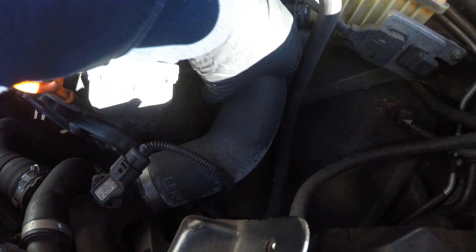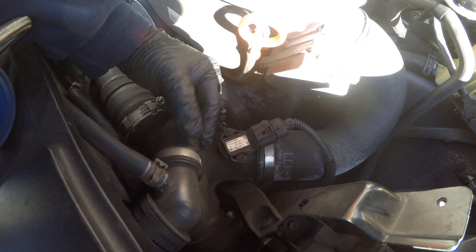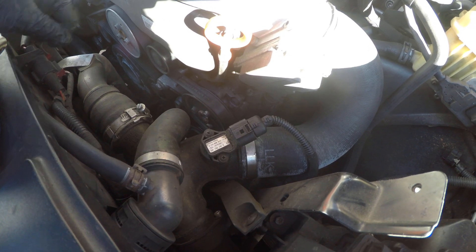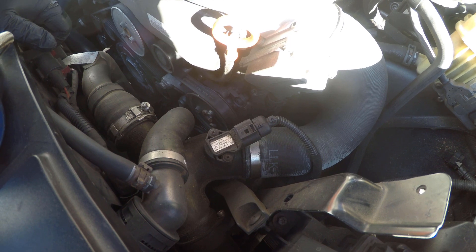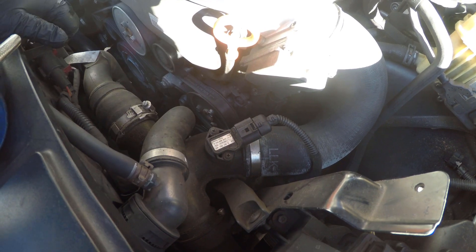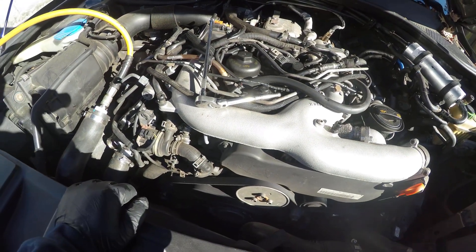That thing's filled nice and solid to the brim — I can't squeeze it. With 40 PSI air pressure in there, the MAP sensor — manifold absolute pressure sensor — has a lot of issues from all the oil and things going through the charge hoses and wearing them out over time. This is a common problem and you'll see overboost codes when that's having issues. It usually also gets oil on it. You can find all sorts of leaks with these fittings pretty easily, including EGR leaks.